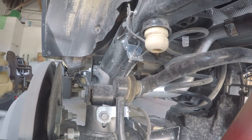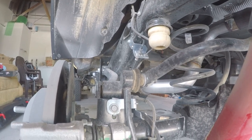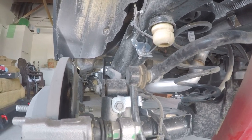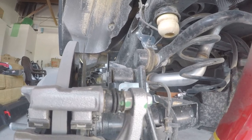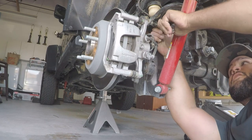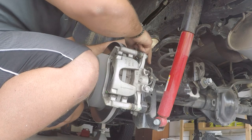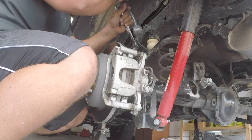The top portion of the rear sway bar link is removed with a 6 millimeter Allen wrench and an 18 millimeter regular wrench. Remember to save this and the hardware for later as you're going to need it on the front end.